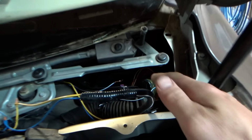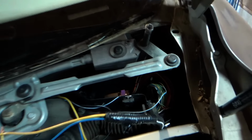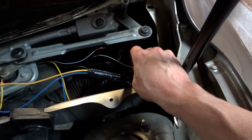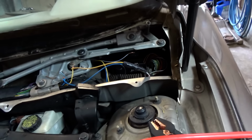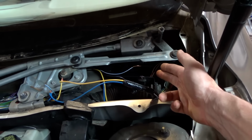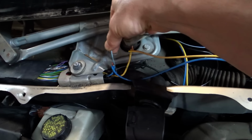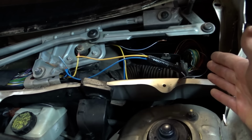And you see the wires going down to the module, and then it's also the fuse box, so you can get to it from the driver's feet there. So these wires, there's a wire here, there's a wire here. These were twisted together, and I kind of did a visual inspection and figured out, well, one of his attempts, he just cut the wire and bypassed it to the wiper motor instead of it going through the original harness. You can see this is the little sense wire, I guess. He did the same for the power, the low and the high speed wires. Obviously that didn't work, but it creates a mess, so I have to restore this before even starting the diagnosis.